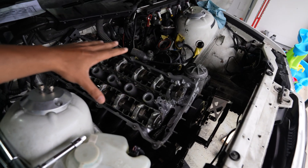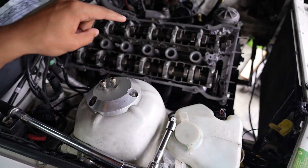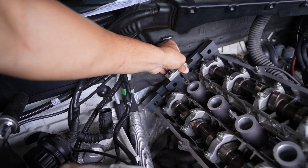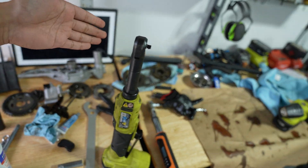I made a lot of progress. The cams are in and everything is tightened up — I torqued to 7 ft-lbs first and then all the way up to 11. A digital torque wrench definitely comes in handy; I'd even recommend getting a bigger one for the head studs since I was struggling to get an accurate reading with the smaller one. We now have the cams with the cam block in place, sitting flush. Next step is getting the block to top dead center and setting all the timing pieces. I'm hoping to have this car started by the weekend.